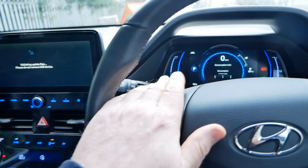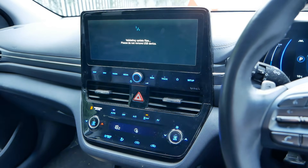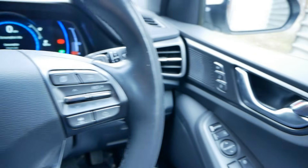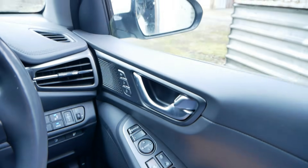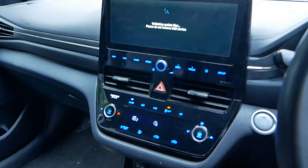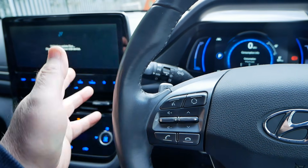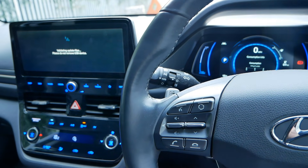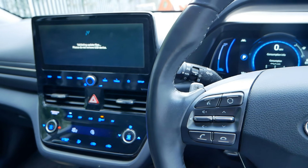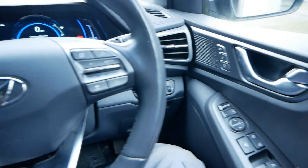During this time you've got to leave the vehicle running — do not switch it off otherwise you will corrupt the data. You can leave the vehicle but leave your key in it. If it's a nice day it's good practice to drop your window, so if the car accidentally locks on you, at least your window is open and you can put your hand inside and open the door. I once locked the keys in a Kia Soul EV while it was running and couldn't get in any of the doors or the boot — it caused a tricky situation.